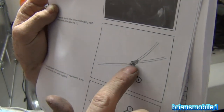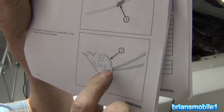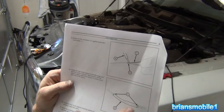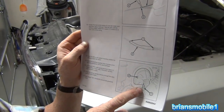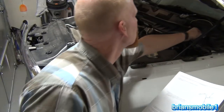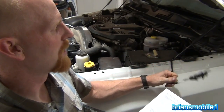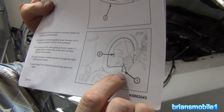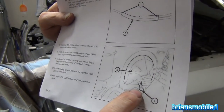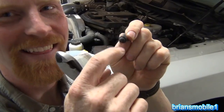What's ironic is that you've got heat shrink for this, but in order for that one to work you'd have to unpin this connection to whatever fuse that is — so do not even use heat shrink. Like a rebel, I'm going to use tape. You just lay it on, crimp it together, crimp it on with the special tool, and then heat shrink appears out of nowhere and you're good. The next thing to do is take the rest of your harness — your purple and yellow wires — and get those through the nipple in the bottom of this boot. It's made to receive this wire harness; you cut the bottom of that nipple off and put them up and through.